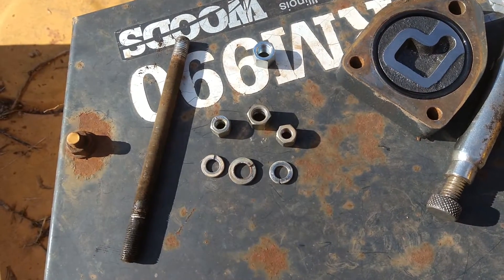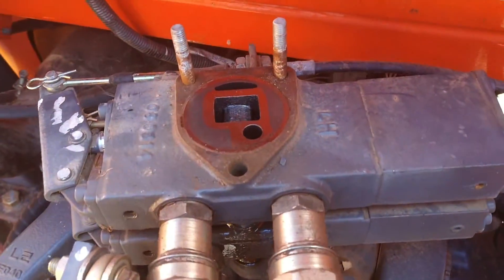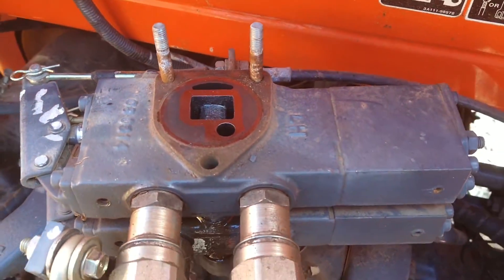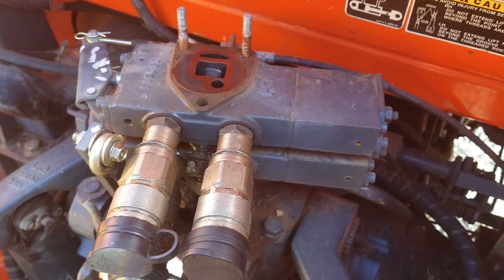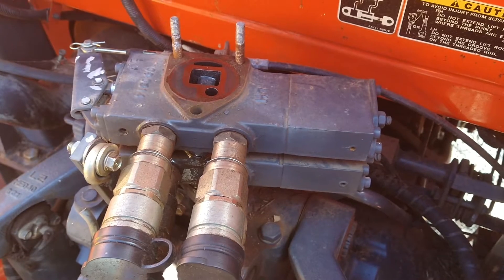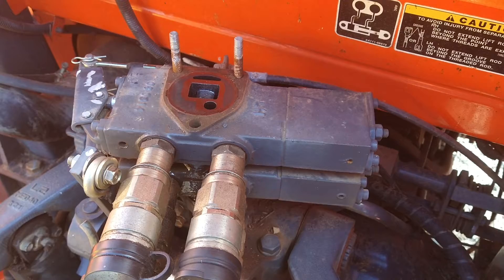It was just stuck on that top cap with some corrosion. Definitely doesn't look like it's worth saving these things — their sacrificial zinc coating has done its job. I'm going to go ahead and pull the other two tie rods and then remove the number two valve and prepare the stack for the new three valves with their new tie rods.